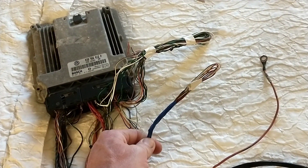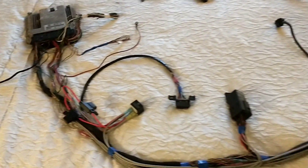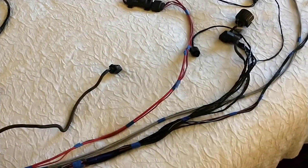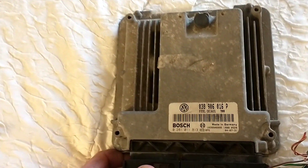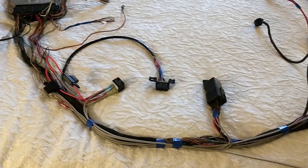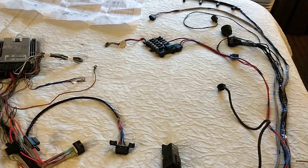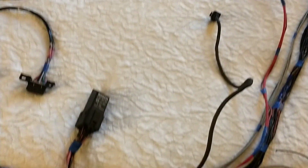I left all the excess wires we don't need right now, as well as the brake and clutch wires — if you're going to set up cruise control you'll need those along with the speed sensor. But that is a quick overview. This should cover any EDC16 harness and ECU, whether it's a BEW or a BHW — those are almost identical — and the BRM harness is really close to the same thing. And your glow plug wires come right out of the glow plug relay and right to your glow plug harness.